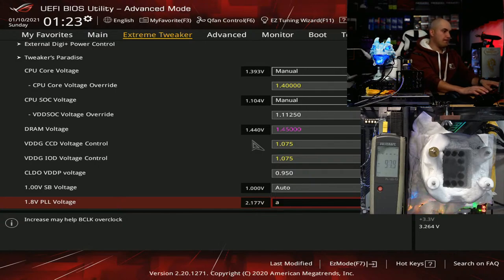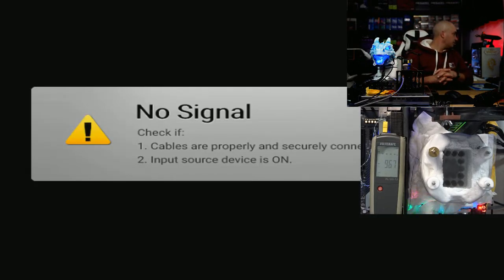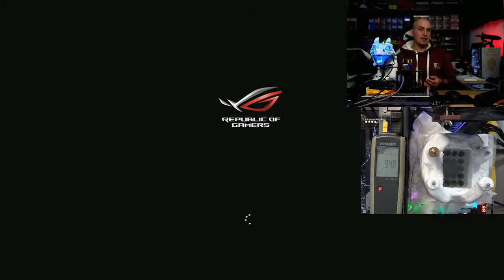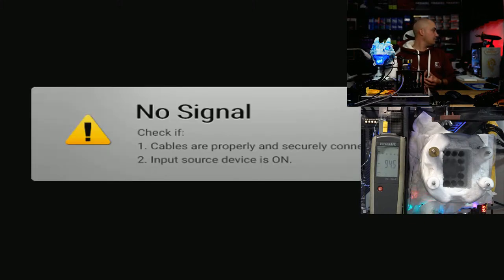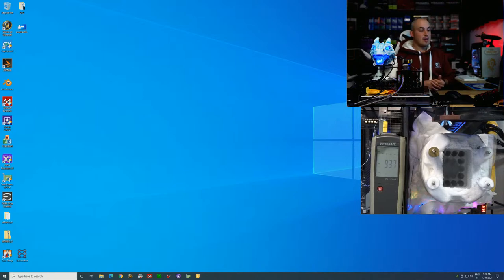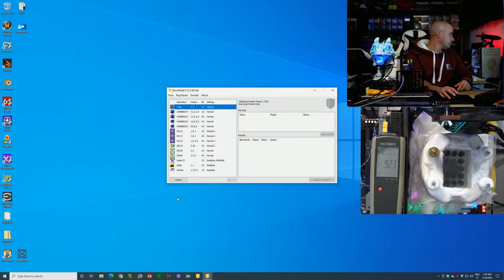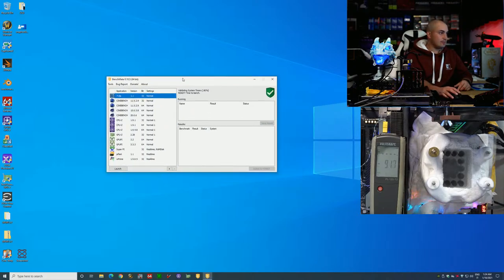Okay. Let's warm it up. It's hard if you go above 3800 MHz. Actually, with this board and this chip, I can do 3800 MHz, 1900 FCLK with four sticks. It runs perfectly fine with the same timings that I'm using on a single kit. I didn't test Geekbench, but in normal gaming, if you are at 3800 MHz with good sub timings, you don't even need two kits. You don't see the difference. But Lumi tested it with Intel. AMD is a bit different.